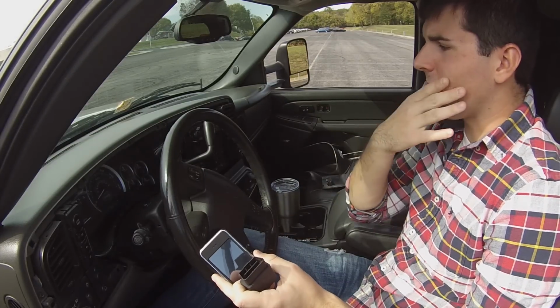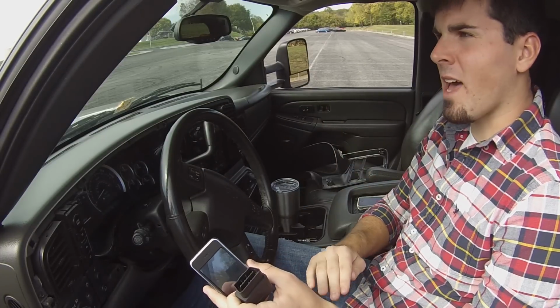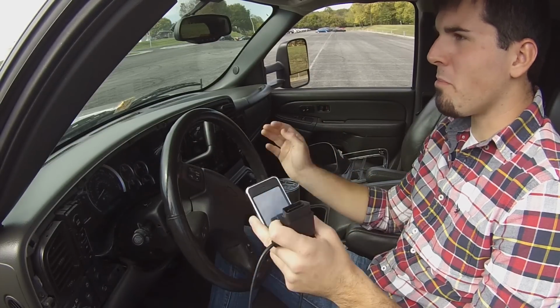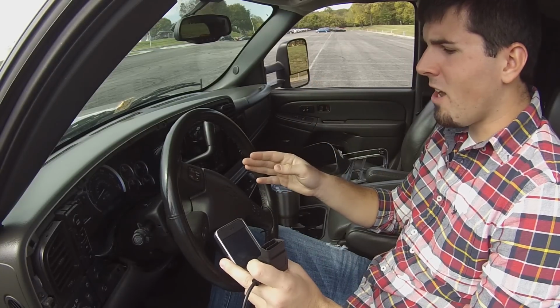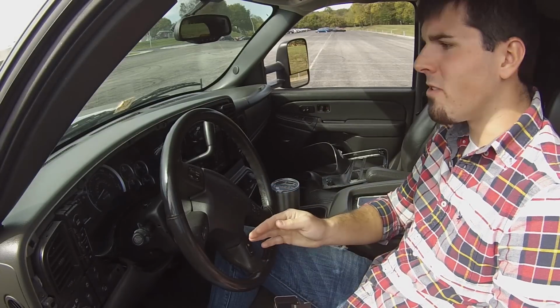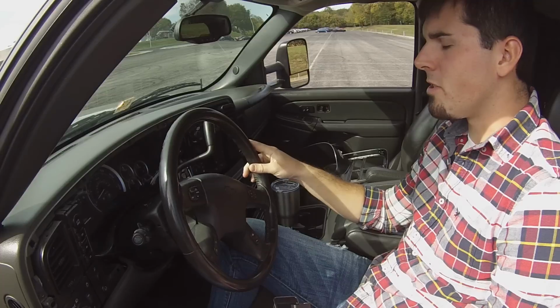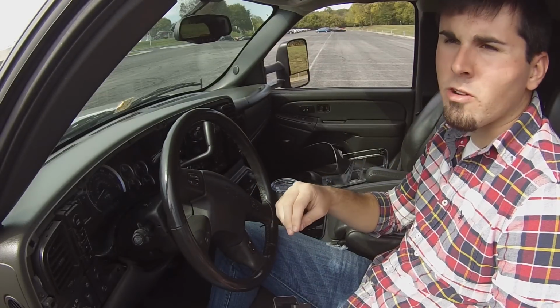Everything's fine. Now you notice there, when I first started the truck, it kind of had that lag. That's the time it's taken for the computer. You've changed what the computer knew to what you've done to it now. Now, I do not remember exactly what Diablo said. I think it's like idle for a certain amount of time, you know, put an X amount of miles on it. But you've got to give the computer time to relearn.